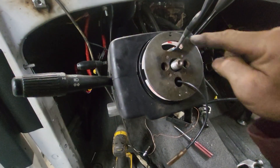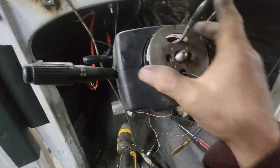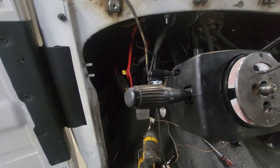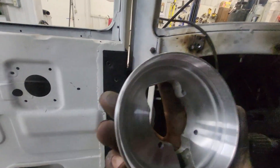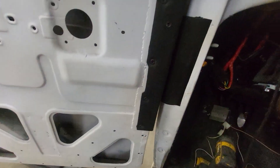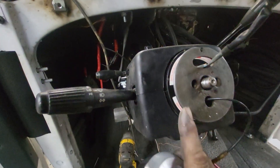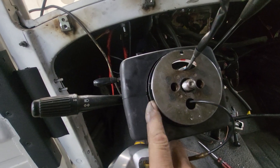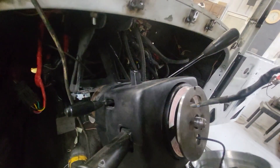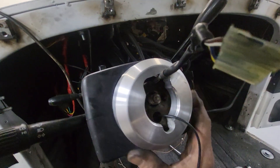What I did is I cut this off of the steering wheel, chucked the backside on the lathe, and made it round — mostly round. I stepped it: you can see that inside step that registers this. The outside step allows it to go around the clock spring, because the clock spring sticks out just a little bit. Then I put the reliefs in it for the holes.